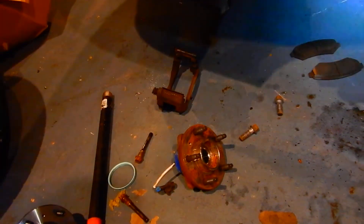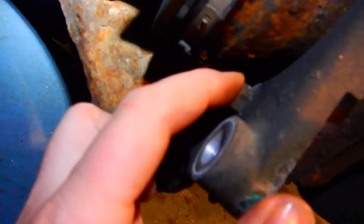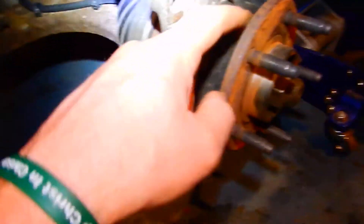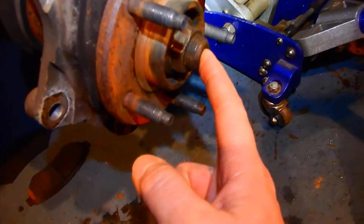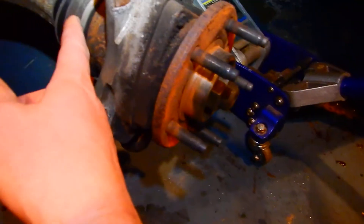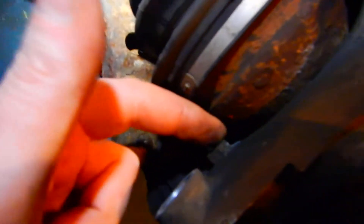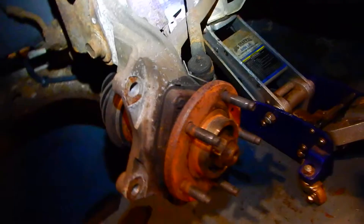Like I said, those cheap hubs only lasted a year. The customer thought they were saving money but it's actually costing them twice as much because they have to do this again. The screws are in a triangle pattern — one here, one on the other side, and one right here. Before you try to take those off, remove the axle nut first, then tap the end of the axle with a rubber hammer to loosen it up. Then you can slide this in and out, and when it comes out you'll have a lot more room to take those screws out.